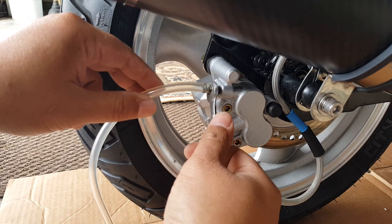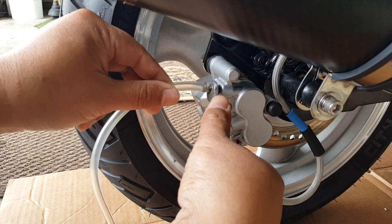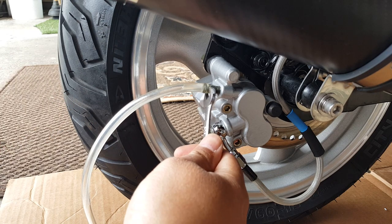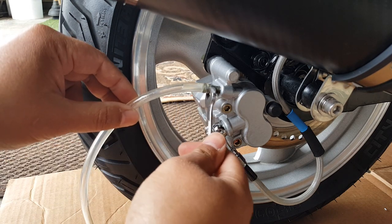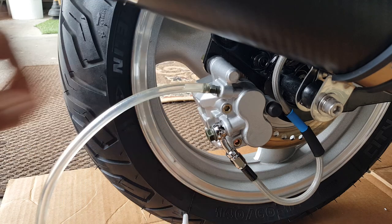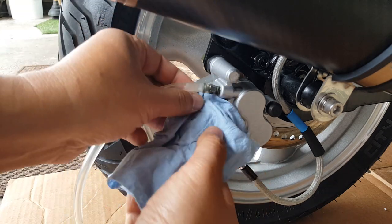So what I'm gonna do is roll up some more. I'm gonna try to roll up to get the thread area dry. I don't mind that it's gonna be a little bit wet all the way deep down, but I just don't want the thread area here to pollute our thread locker before it gets a chance to, you know what I mean, harden.